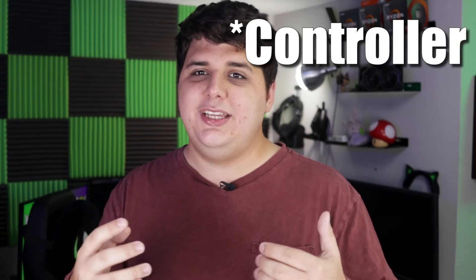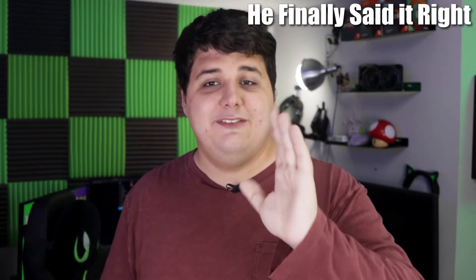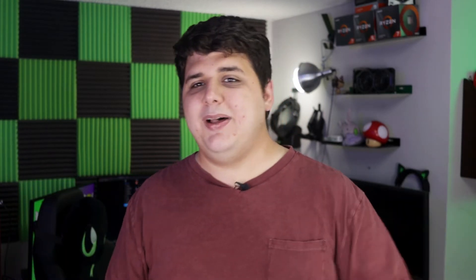There are a couple of answers — there's the free answer and then there's the one I've found works the most. The first one is move your ports around. Most likely your motherboard, if it's a bit more expensive, has more than one USB bus. Mine are conveniently labeled on the back of the motherboard, but they're not always labeled. Try your front ports if you're having issues with your back ports — those are usually on a separate bus. If you have USB-C, that port is usually on its own controller, 100% separate from everything else. You can move low-bandwidth things onto the same bus and just move things around.